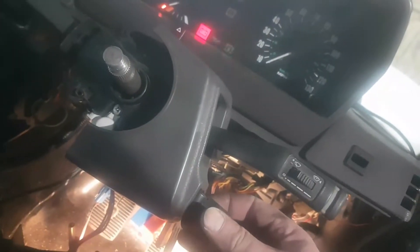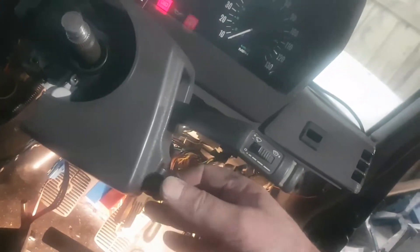Not getting a whole lot in the wiper department, and no rear wipers either — so no wipers. No blower either. The blower and the wipers front and back aren't working, so that's the next thing to look at on the diagram. Door looms aren't connected on that side. They are connected on this side, but the mirror switch doesn't seem to work — it's a really manky mirror switch, feels like it's full of sand. I'll see if we've got another one in the box of bits.